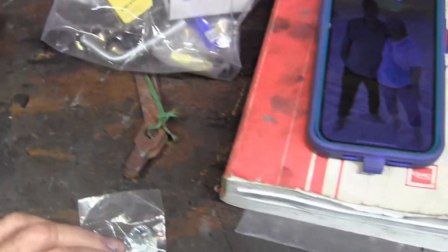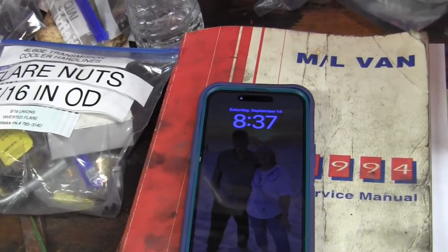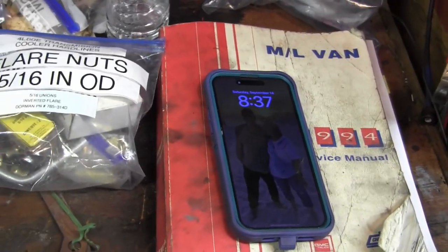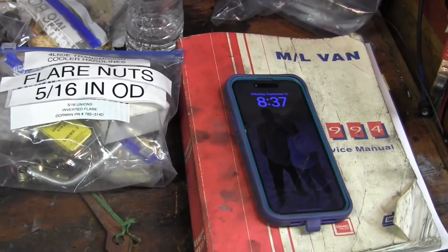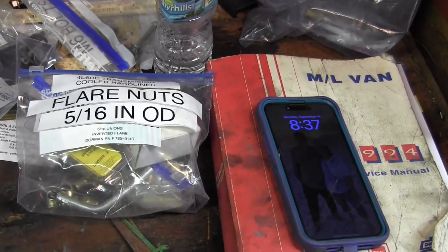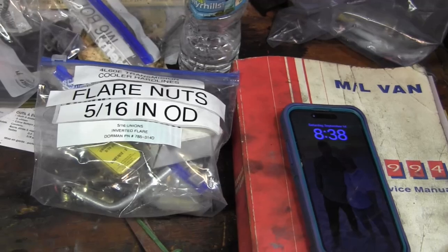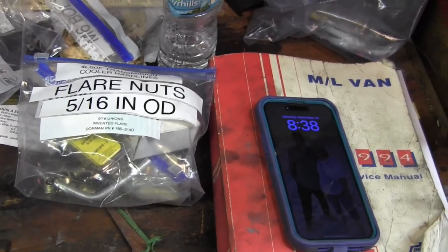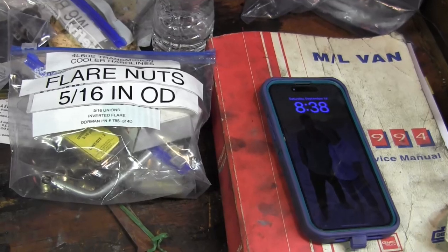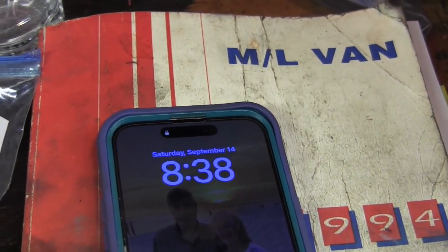Yesterday I did do a little more work on the van in between the rain showers, and I have a lot to do today, and we'll talk about that as we get into it. I really don't know how much I'll get done today, but I would have done myself a big favor had I separated the blade and the thermal assembly from the water pump and just installed the water pump, because it would have been a fraction of the weight, and I probably wouldn't have made such a big mistake installing it. I put coolant in it, and the coolant's going somewhere, but it's not a large volume like it was before, so I assume I may have other things to look into regarding loss of fluids once I get further into the work I plan to do today. It's 8:38 now, so I'm going to stop talking and get to work.